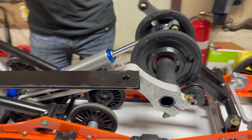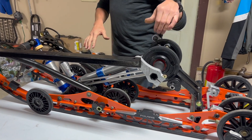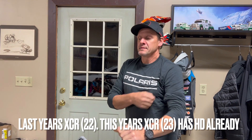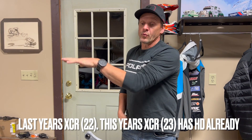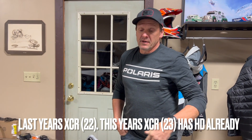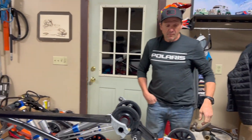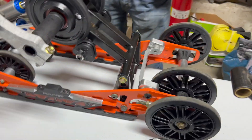These springs have a lot to do with it all because we are dealing with using all of the springs. The springs that come on an XCR or VR1 are on the soft side - depending on what riding you're doing - but it doesn't take much to be a 160 or 170 pound rider and have those springs not be enough if you're going down the trails hard. We saw it last year over and over. We got boxes of those springs coming back.